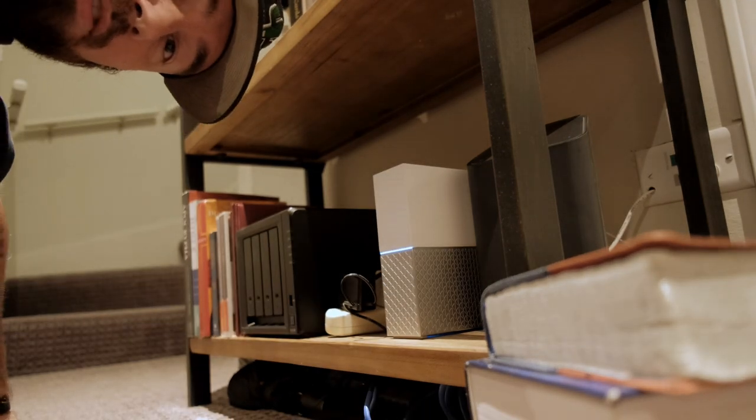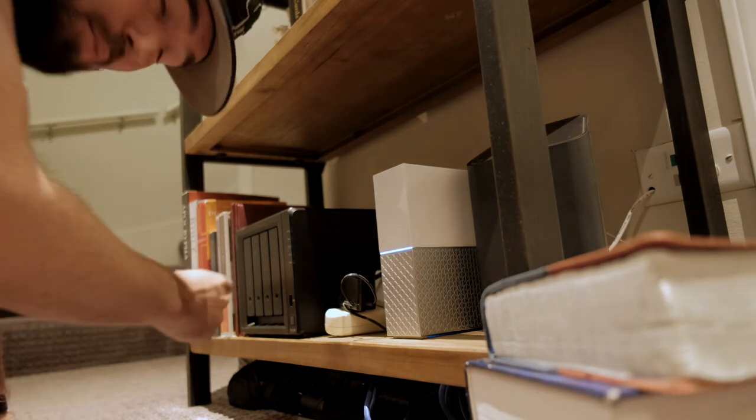That was easy enough, kind of. Now we've got to set it up. I already put a hard drive in here — you didn't see that part. So now I'm at the computer in my browser. I'm going to go to find.synology.com. It's currently searching for the Synology device. There we go — it has been found. I've read the terms, because we all do that. Installing the DiskStation Manager. All data on hard disk one will be removed during this installation, but there's nothing on it — it's a brand new hard drive. Ten minutes. We'll be back.